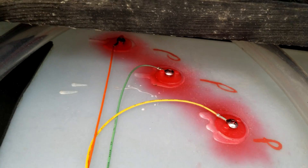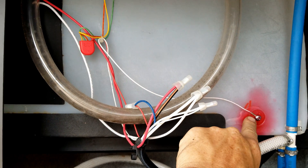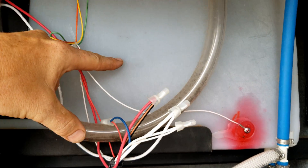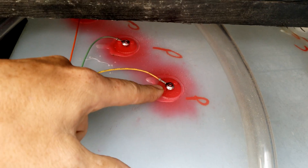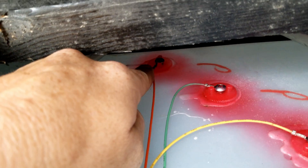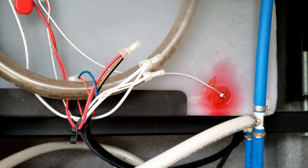What you're seeing here are the sensors — there's going to be another video about sensors, but just a quick rundown. This bottom sensor is grounded to the chassis. As the water fills and travels up the tank, it makes contact with the additional sensors and gives you the next reading, whether it be quarter, one-third, two-thirds, and eventually full. When the water reaches the top, this ground signal grounds out the LED lights on the monitor panel and tells you the tank is full.